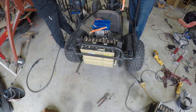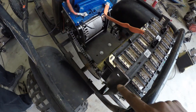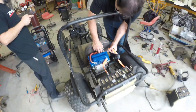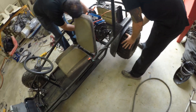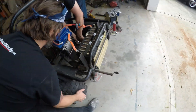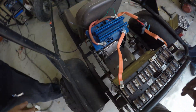All right guys, let's go over the modifications. Here is the battery box, and as you can see there are more batteries here — now 72 volts — and it's a little bit more safe versus just the straps. Brian helped me weld a bracket on the back, and there is the bracket from the Bud's electric motorcycle build. Brian also helped me from killing myself by strapping those down. We got zip ties so the controller is no longer moving. He's helping me wire it up now, and then we're going to do the full 72 volt send. We're doing final brake adjustments, because braking is going to be absolutely necessary. 12 volt balance beam battery in the front. Brian put his touches on the safety — the wiring looks way cleaner than I did. And we got the battery tray that Brian welded in. No more straps, guys.